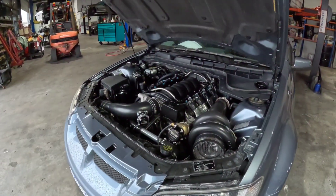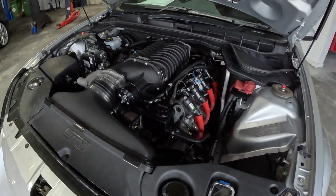However, because I get to drive all of these cars after tuning them, my honest opinion is that on the street, depending on where you live, the supercharger is probably more fun in the low ranges depending on how you drive. The turbocharger is essentially lazier but with big legs. If you've got big wide open roads the turbocharger is just so much more fun — you get up it and it just pulls like a freight train. But to say the supercharger doesn't pull like a freight train — these do too, and they're snappier with way more power off the bottom.